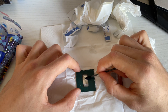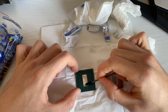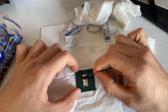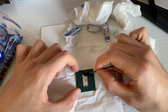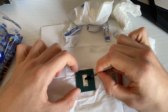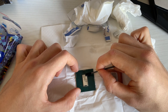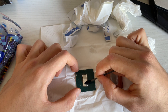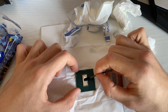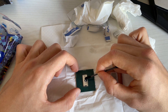This is actually a perfect amount. I thought it was a bit too much, but since we're also going to reapply it on the IHS, it's just right. Try not to go over the borders, but if you use nail polish properly it's not going to damage your CPU. With a copper IHS and liquid metal, performance actually gets better the more you reapply it, because once the alloy forms — the part we can't remove — it has much better adhesion. Now we've applied it perfectly.